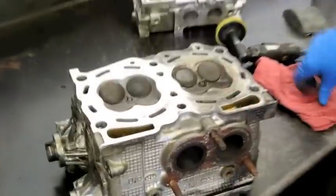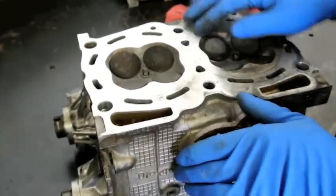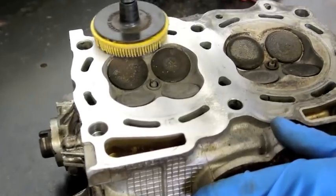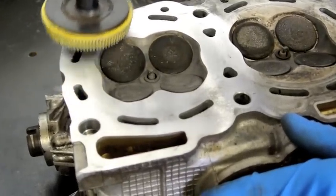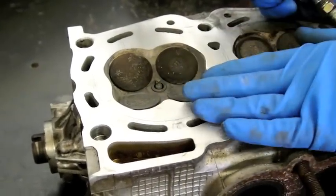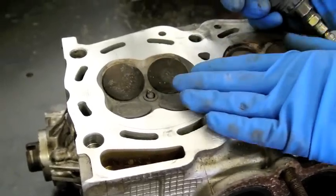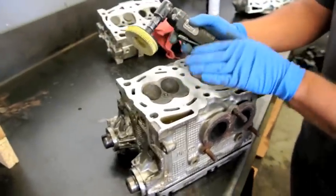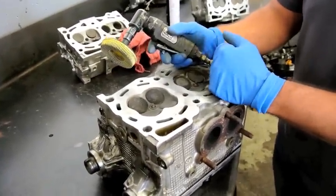As you can see, very quick work of getting the cylinder head clean, and we could probably go at it a little more, but I'm just trying to get a point across. What it does is it creates scratches. Not to mention that when the whiz wheel is going over the surface, even though I might do everything I can to try to keep it straight, it has no choice but to round off these edges. That removes surface material, and the more surface material we remove, the less likely this head gasket repair is going to last for a long time, which is what you want. You don't want to have to do this again, which is why I'm showing you.